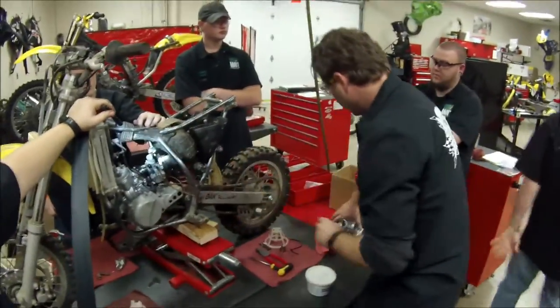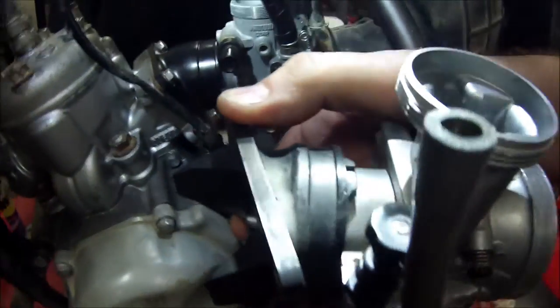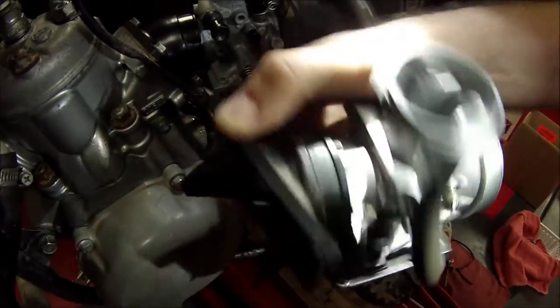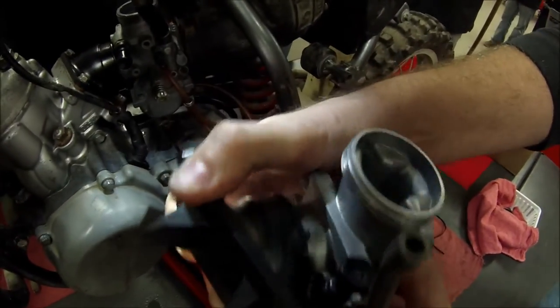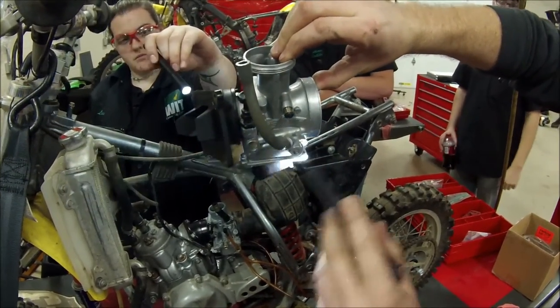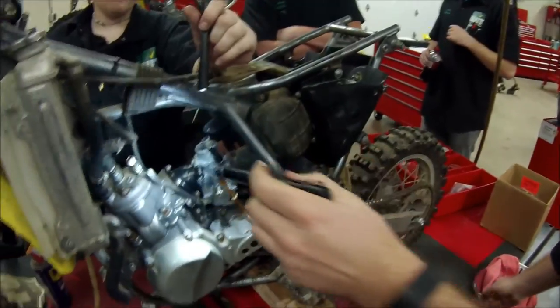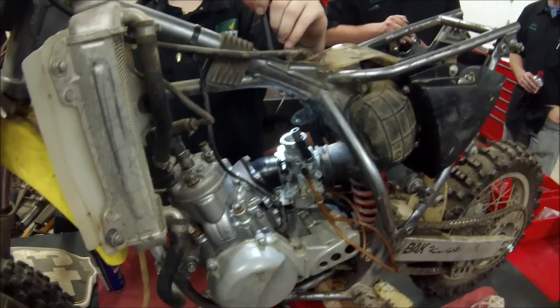Every mechanic should know that's how to fully seat a carburetor. The big reason for those tabs is so that the carburetor sits in the right position — it's firmly bolted to the engine on the manifold. We would not want the carburetor tilted, because that affects your fuel level. If the carburetor is installed tipped, the fuel level is going to be altered. So on engines without locating tabs, how do you install the carburetor? Straight up and down.